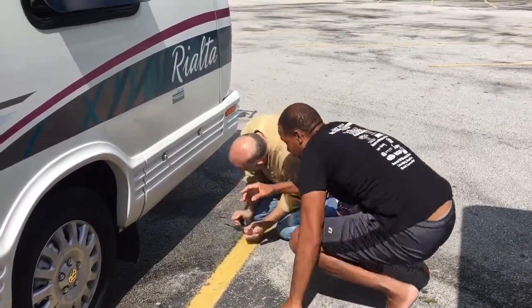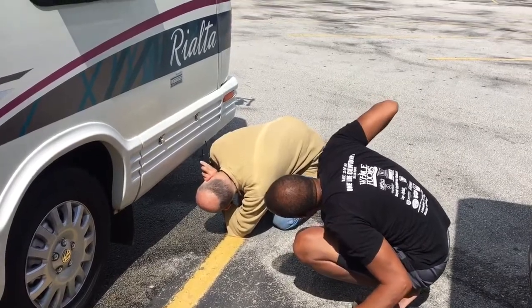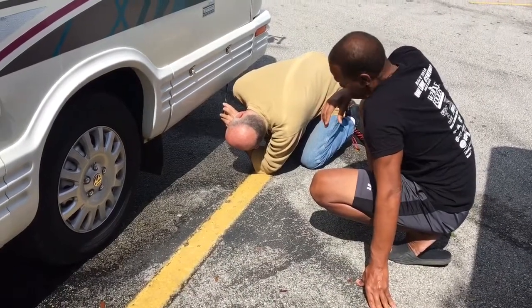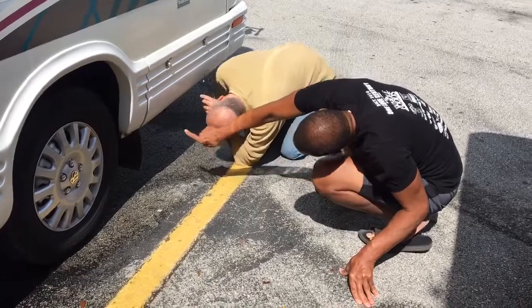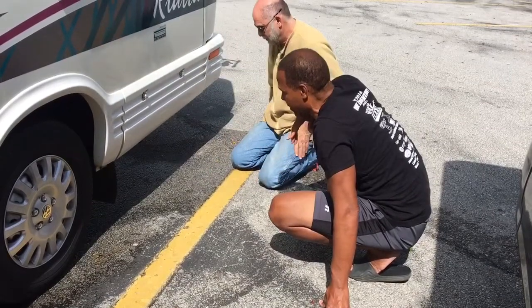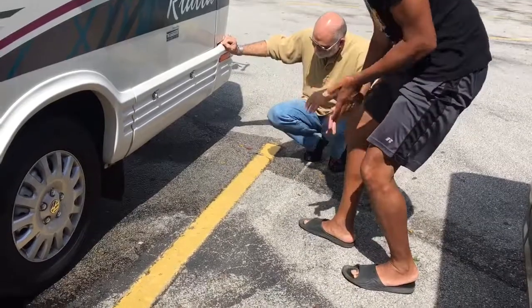Now the muffler, I'm going to be able to raise that up about another inch, maybe inch and a half. I left a little extra room initially so that I could make sure I could connect the exhaust pipe there that comes down from the inside. But I'm going to be able to raise that up enough so that we'll get a little more ground clearance out of it.